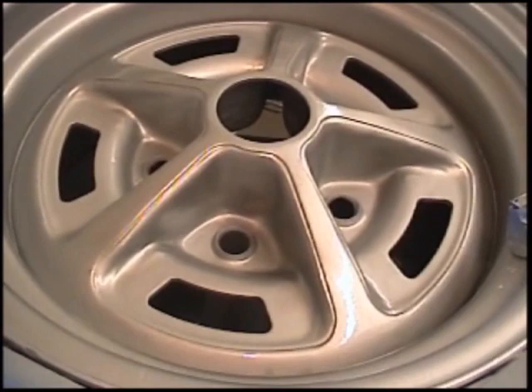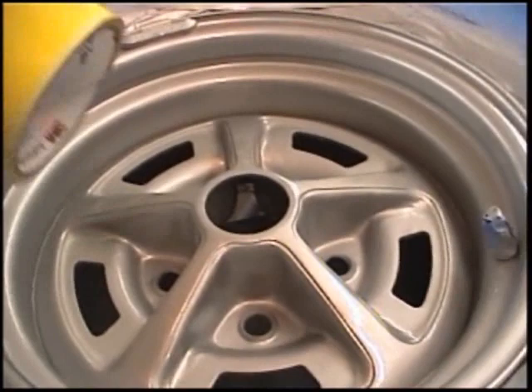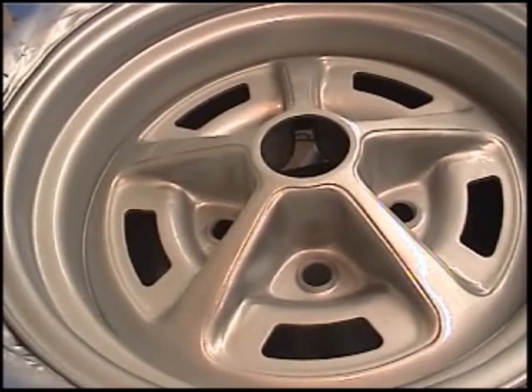On the internet they do make a template for the insert on these wheels, and you can get them on eBay or look online. I chose to make my own template. What you do is take a piece of masking tape, cut off a strip, and put it along one of the spokes. As you lay the tape down, take a pencil and rub the edges — it leaves a guide on the tape. Then take scissors and cut that out.